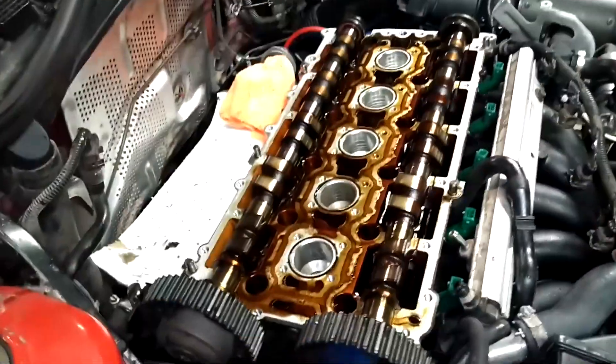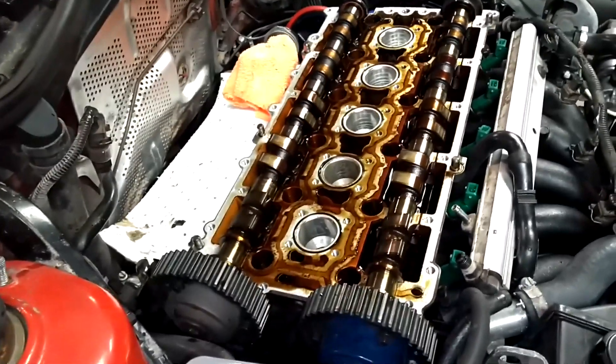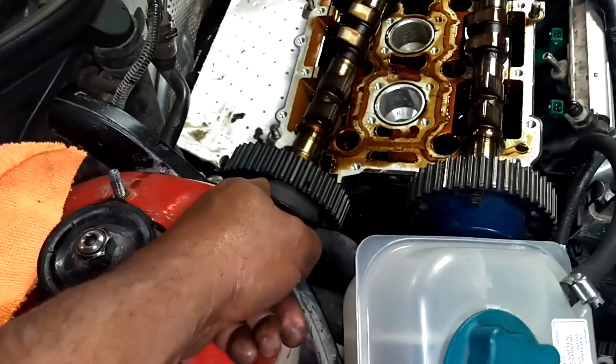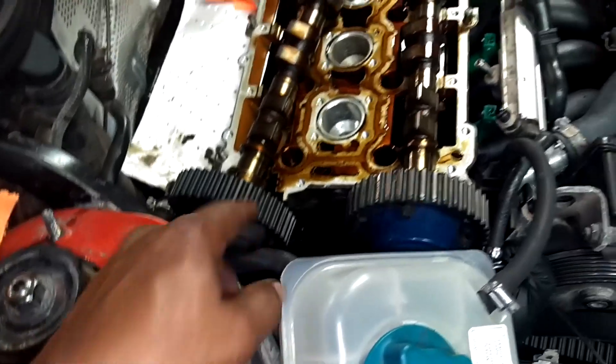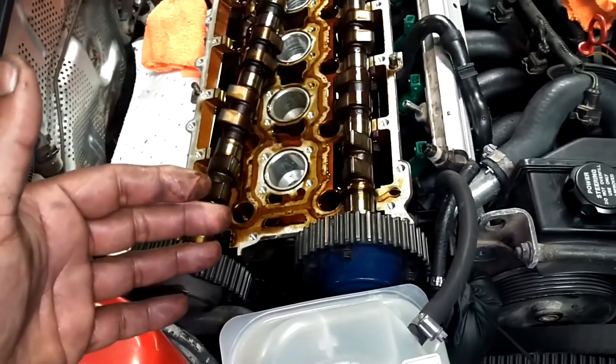Pick up the cover from the front, then from the back. Critical point — warning: do not proceed without paying close attention. I wrestled these cams out because another one of the screws was hitting the bottom of the head. So it's probably best to take two of the screws — the one near the top and the one near the bottom front — and back those out. That way it'll be easier to get that cam out of the head. Hope that helps you understand. Thanks for watching.